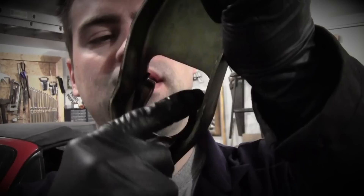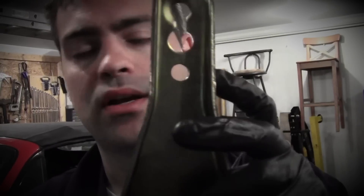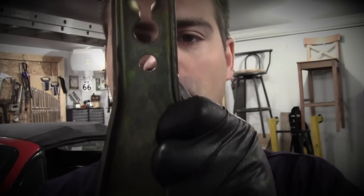I've got a brand new clutch fork. My old clutch fork — the one that came with the transmission — had a little retainer spring clip that holds the throw bearing, and one of the sides was snapped off, so I had to buy a new one. The kit installation manual requires you to drill a 7/16 inch hole in it for this little guy to go through and push on the clutch fork. It's important to know that has to be done with a carbide-tipped drill bit because this is hardened steel and very dense. I didn't get footage of it since I don't have a drill press — a little bit harder to do — but I got the hole in there and we're good to go.